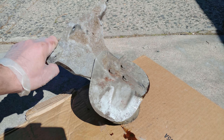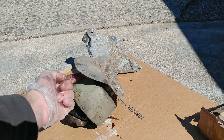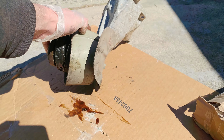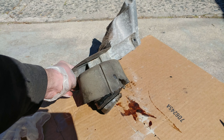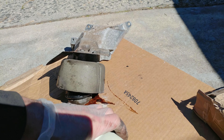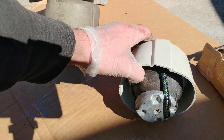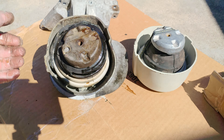Obviously to remove it you can't just get to the bolts easily. The newer style mount has a small intermediate plate that sits right here — two bolts on the bottom allow you to separate the intermediate plate from the holder from under the car. I believe Mercedes started implementing this around 2005 or 2006. On earlier cars you can't do that. I also heard that SL600 and SL65 can't be done this way due to a different power steering rack arrangement. Here's a brand new mount — I had these mounts for my CL600, and since those were already replaced, I'm going to use them on this S600 — same mounts.